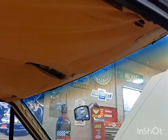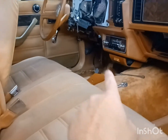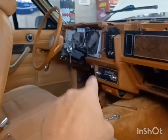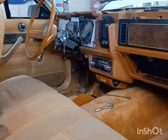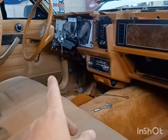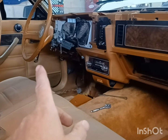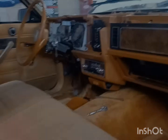That's really the only thing I'm going to do in the interior. I may end up having to put a set of bucket seats in it because I'm going five speed, getting rid of the shift column. Everything under this car is going to become V8-oriented. I've got an 89 GT I'm stripping everything out of and I'm going to put into this car.